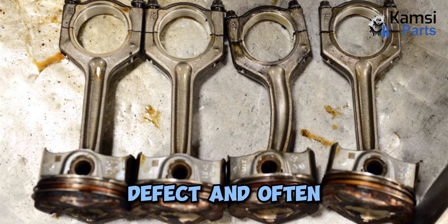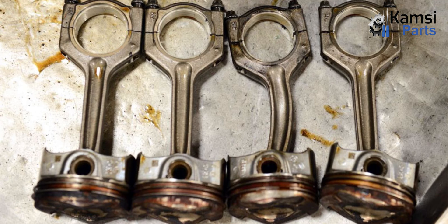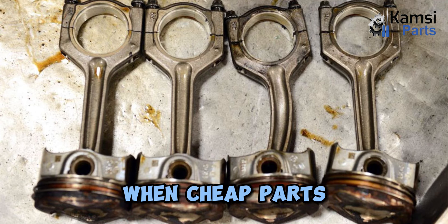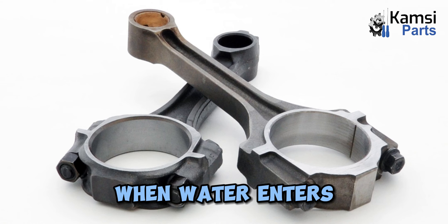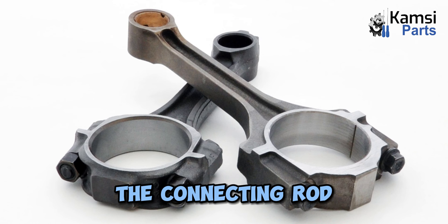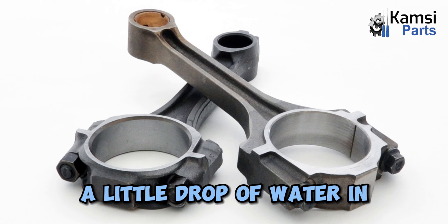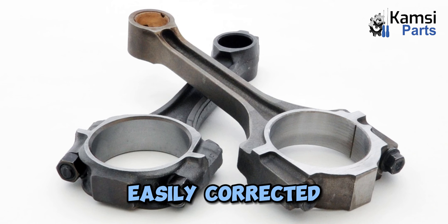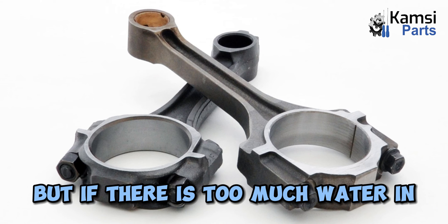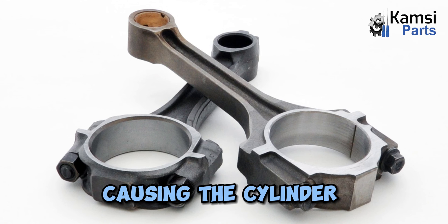This is the most common type of defect and often occurs in older engines as well, if the engine is rebuilt. You may also experience fatigue when adding a new engine if cheap parts or wrong parts are used. 2. Hydro-lock: Hydro-lock occurs when water enters the piston chamber, causing deformation of the connecting rod. This may occur when vehicles pass through a flooded road. A little drop of water in the cylinder can produce knocking or tapping in the engine that can be easily corrected. But if there is too much water in the cylinder, the spark fires erratically, causing the connecting rod to tilt or break.